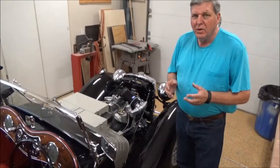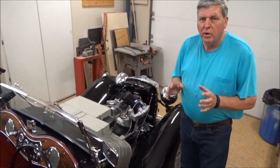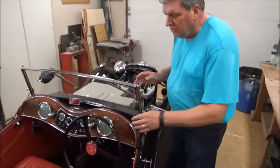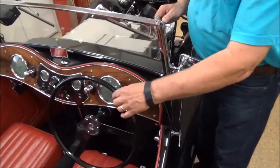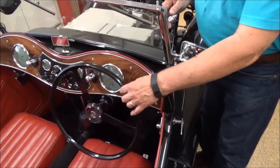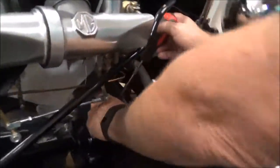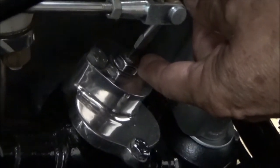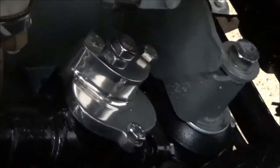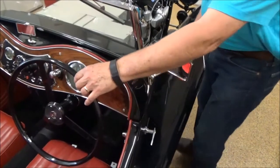In order to find out if the steering box needs to be adjusted or set up, we need to do a very simple test: with your car in the static position, just see how much play you have in the wheel. Right now we've got four to five inches, indicating excessive play. So the first step is to adjust the Tompkins kit — I've got the nut already loose so I can put the screwdriver in the top and I'm going to just tighten it down until it's snug. Let's go back to the steering wheel and see if there's any play. That actually takes care of most of it.